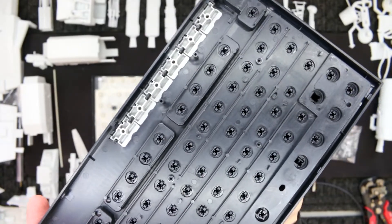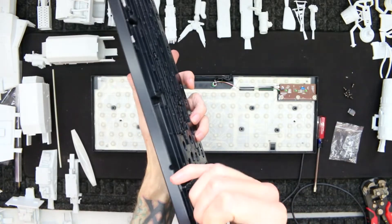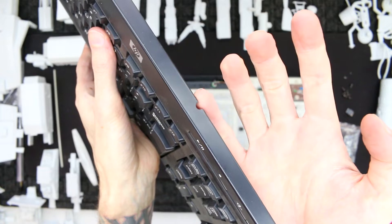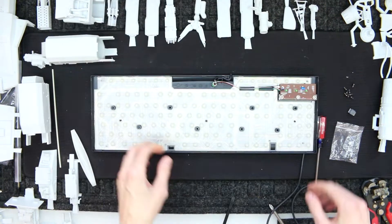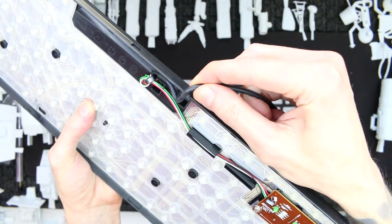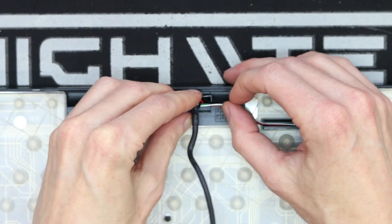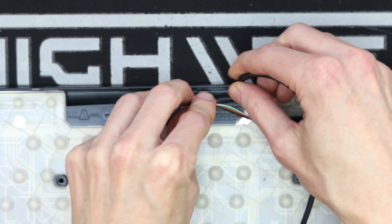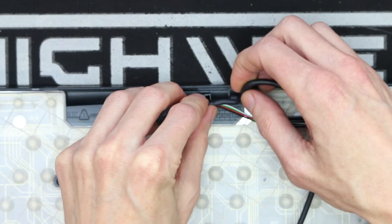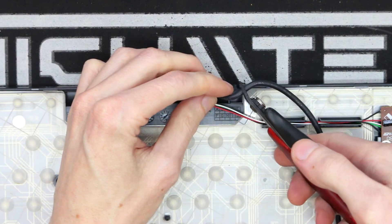Here's the inner workings of a rubber dome — I think it looks pretty cool. I'm going to show you where I'm going to be modifying the hole for the port. You don't have to put it here; you can have your port anywhere on the keyboard case, wherever you want. This keyboard already has a hole in the back, so I'm just going to use some of that hole, but I do have to make it bigger. For the inner USB wires, you want to give yourself enough slack to make soldering and management easier — err on the side of too long rather than too short. After mocking up roughly where I wanted it, I went ahead and made the cut.